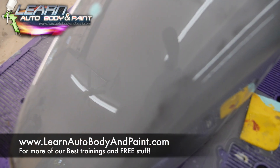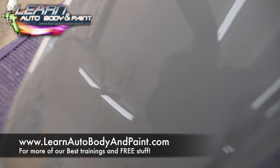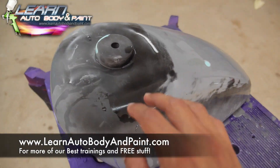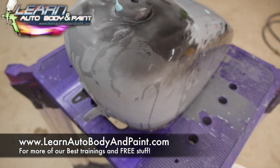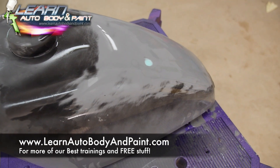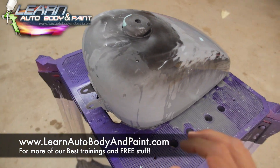Because when you have your clear coat on it, this is basically how it's going to look — you can see the reflection of the fan up on top there and how nice that looks. We're going to go ahead and finish sanding this area. If we have any spots like the glaze putty areas, we could 1K prime it with a spray can, or if you're mixing some up, you could spray some 2K back over it and hit those spots again. You basically want the whole thing gray again, one color, before you start basing.